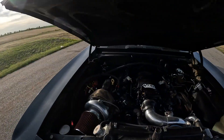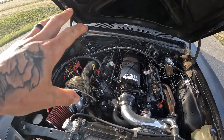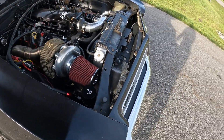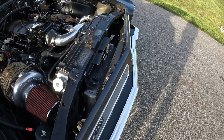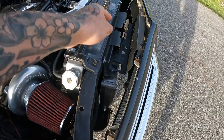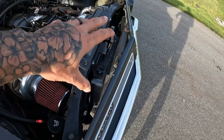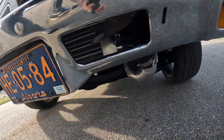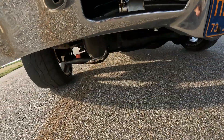Single 78-75 turbo. It's actually meant for the first gen Camaro, but everyone knows it's the same subframe and stuff as the Novas and Pontiacs and Buicks. The only thing I had to change was the intercooler. The one they supplied was thick, long, well made, heavy — a good cooler — but it didn't fit. The outlets were kind of out front or meant to go backwards. Something was different in the front, so I had to buy just an Amazon one. Turned out pretty good, got it to fit up pretty well with the stock piping — I had to modify one pipe the most to fit.